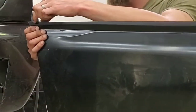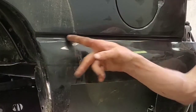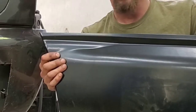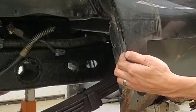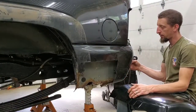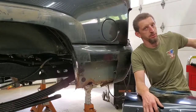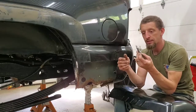If you look, there is the body seam, which is right here, which is going to coincide with this body seam, and then they give you a little bit of surface area right above it for either panel bond or spot welds. In here there are spot welds, so we're going to drill these out on this side, and then on the back side of the panel you are going to need a spot weld cutter, as far as a specialty tool. You can get them on Amazon. Obviously this one will be linked in the description.